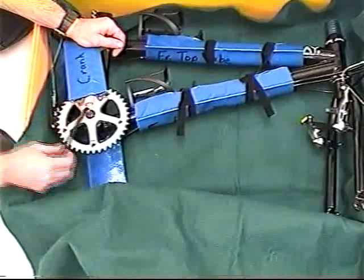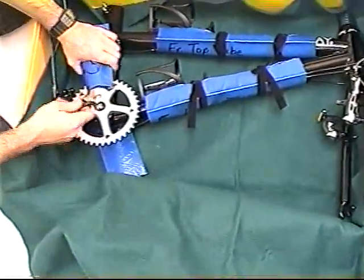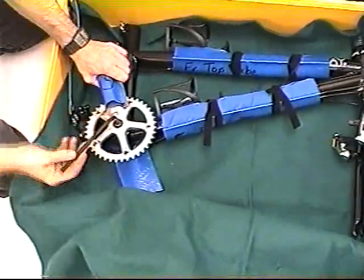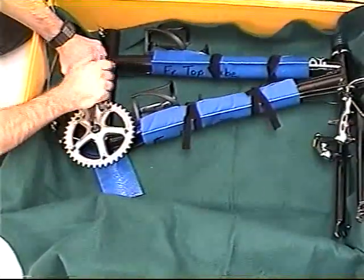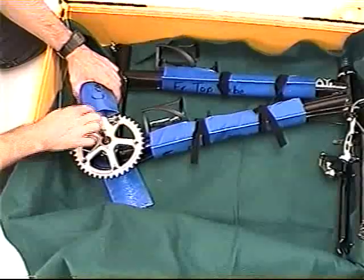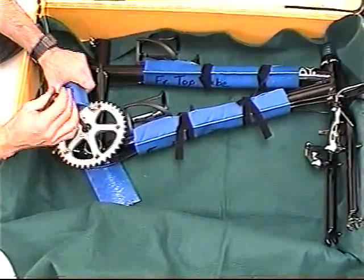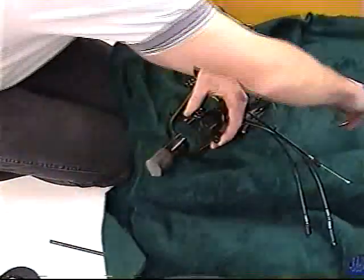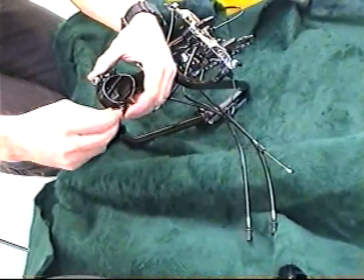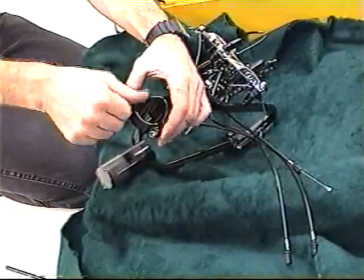To pack the bike into a single suitcase, you'll need to remove the right cranks on the front portion of the bicycle. To use the one key release, use the allen wrench in your tool kit to turn the crank bolt counterclockwise. At first it'll seem a little bit loose and then it'll tighten up again. As it tightens up, continue to turn it counterclockwise until the crank is fully extracted off the bottom bracket. If you have questions about disassembling your Project Q to work as a single bike, go back to converting your Q to a single.